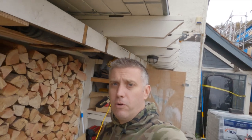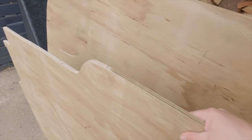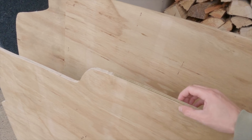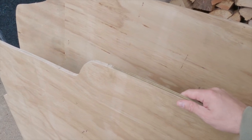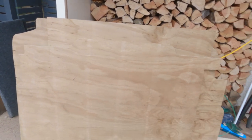The next part of the floor is the actual floor itself and we're just using plywood — pretty simple. This is treated ply, 10mm, so still pretty lightweight but also allows us to fix anything to it. I've already cut it out. For the floor there's three bits, and I'm going to fix that plywood by screwing it with some self-tapping screws into the aluminium. By screwing it in, that allows us to unscrew it and pull it back out — I'm not going to glue it in the early stages.